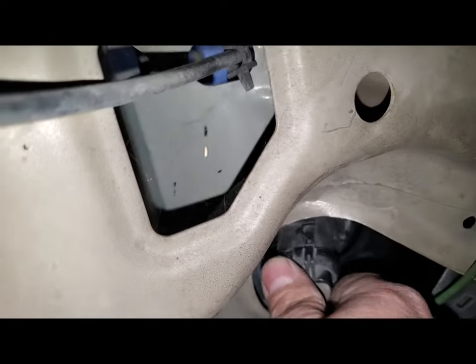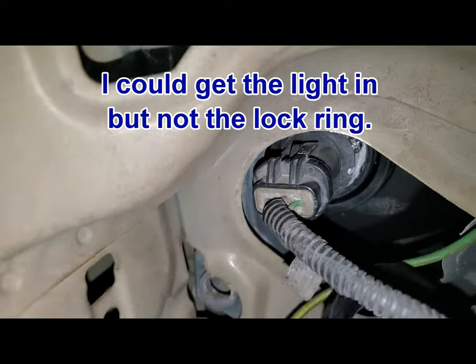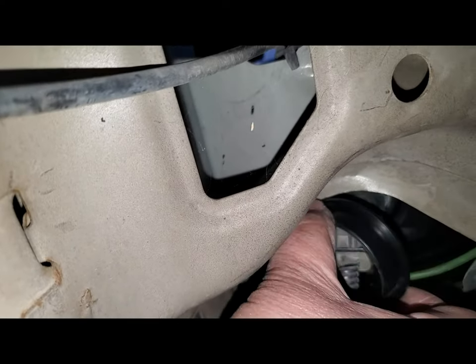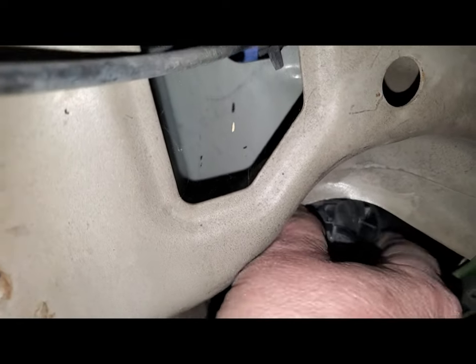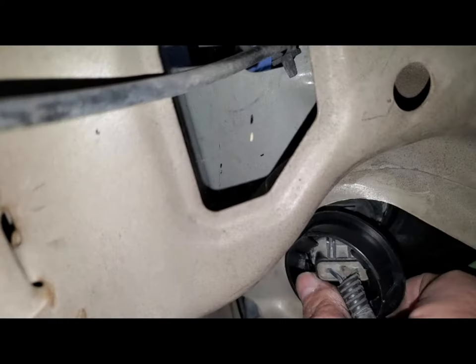Here's why I told you to install the ring first: on this particular light bulb assembly, this portion will interfere with the frame and you won't be able to install the ring while it's in the vehicle. You have to do it with the assembly out, or pull the two clips and lean the assembly forward to change the bulb later. This assembly is a no-cut, no-mod installation — completely reversible — which is why I recommend it.